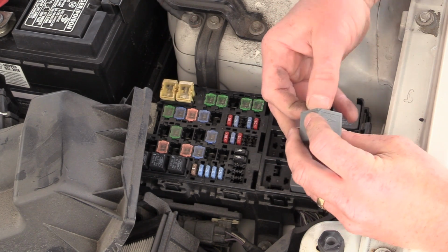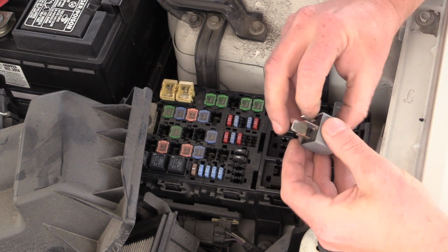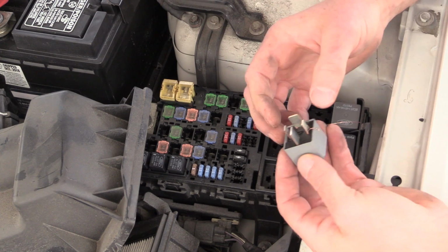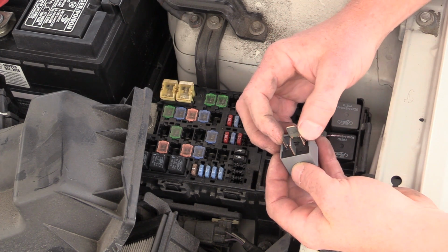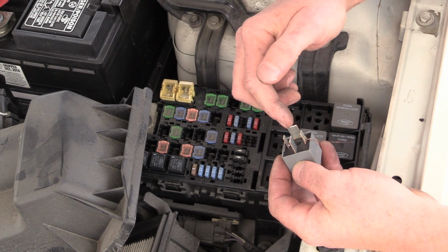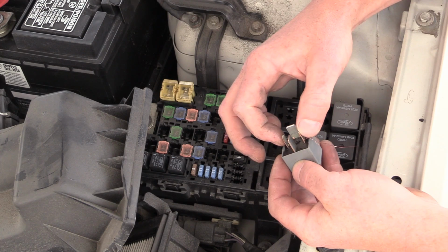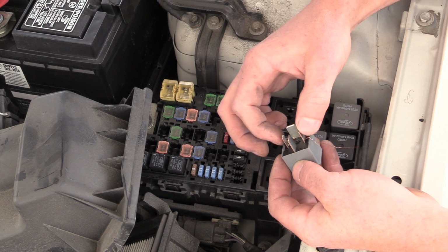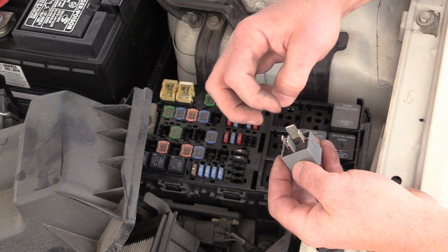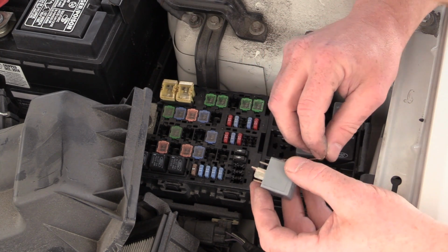Is the plan. A lot of guys will want to, you know, maybe energize the relay and then use an ohm meter. So you can energize these two pins with jumper wires and then use an ohm meter between these two pins. And it should be infinity open when these are not energized. And when these two are energized, the coil closes the switch, and then those two should show 0 ohms. I don't like that test.